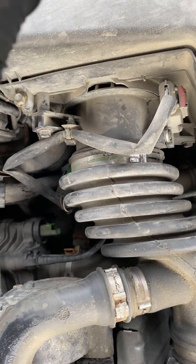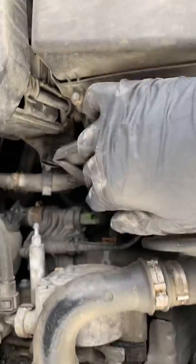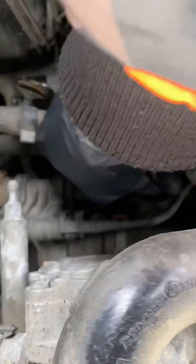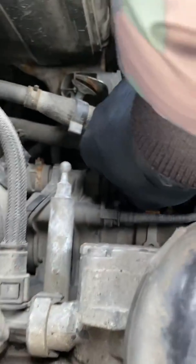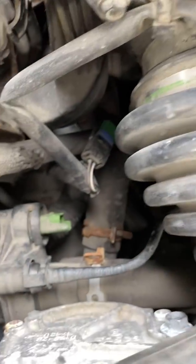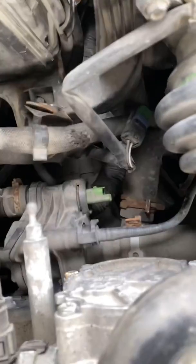There's what looks like algae or coolant residue growing on the bottom of the old clip, but we've got a new one anyway. Grab the neck of the connector and give it a wiggle — you can see there is movement in it. As you're wiggling, pull back on it gently. Don't use pliers or anything like that; your fingers are fine. You can see the body of the sensor is already moving out from where the clip was holding it.